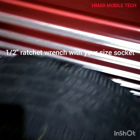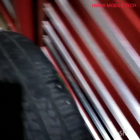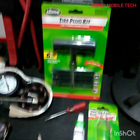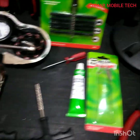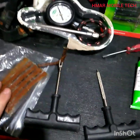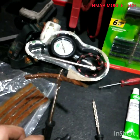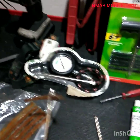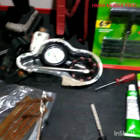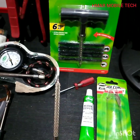Here's the screw that's stuck in the tire. What you'll need is a tire plug kit and rubber cement. Feed one of these little plugs through the tool that looks like a needle — you'll thread it through like a needle and thread. Then you'll use this reamer tool to clean out the hole that the screw or nail was in.